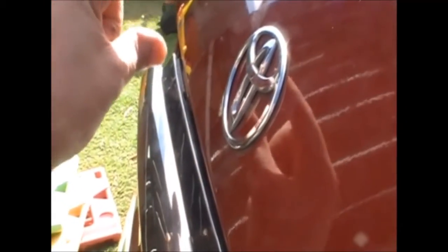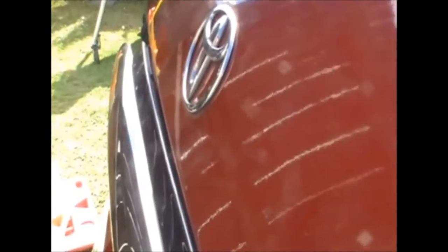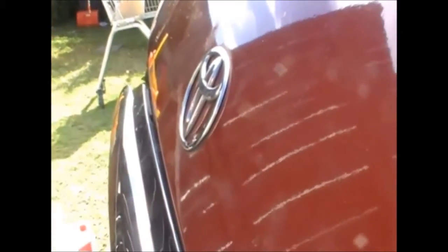The side that already had the bolt holes comes off probably about 5mm. The other side where I drilled the hole has probably close to a centimetre gap difference, and that's bolted up hard against it. So I'm going to make that end a larger area where it can slide up and down, so the first three that bolt in will pull it into where it should be, I hope, and the fourth one can bolt up to wherever the rest of it's aligned to. Yeah, see how we go with that.